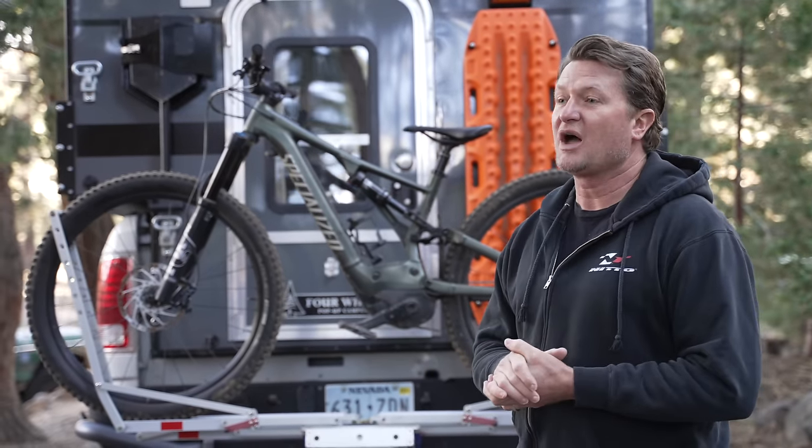On my Ford, when I originally built this truck I was running 40-inch tires - there's a 40-inch Nitto Trail Grappler in the bed. Currently I'm running 42-inch Trail Grapplers on 20-inch trail-ready bead locks, but I couldn't package a 42 in the bed between the shock hoops for the bypass shocks, so I'm still running the 40 in the back. It takes up a ton of space. When I went to Alaska, my friend Brad and I built a rack flush with the bed and had another level of storage for boxes, duffel bags, and things like that because the spare takes up a lot of room. There are some advantages - having the weight of the spare, the batteries in the DZ box, and a 36-gallon fuel tank all towards the back really helps balance the truck and keeps the rear from bucking through whoops. But for day-to-day use, most of the bed space is taken up, which is less than ideal.